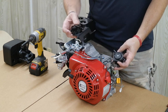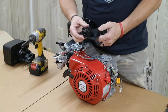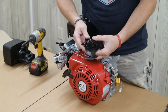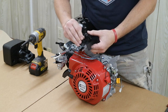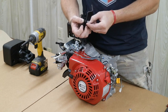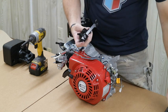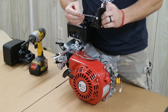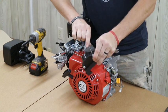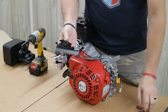This fuel pump mounting bracket comes with hardware. We need to locate the in and the out on our fuel pump — we want our inlet going forward and our outlet towards the carburetor. We're going to put these Allen head bolts in from the top with a quarter-20 lock nut on the bottom. Start both of them, then use a 5/32nd Allen wrench and 7/16 wrench to snug them up. Now my fuel pump is secured to the top plate.